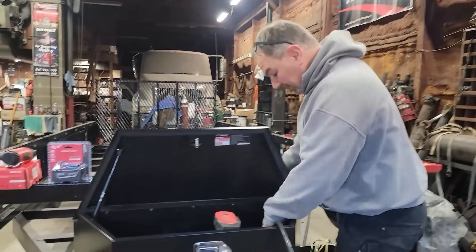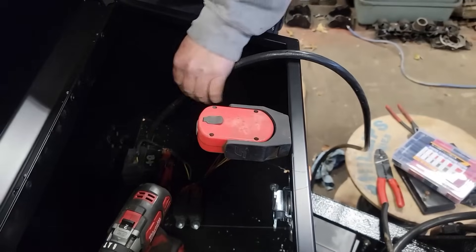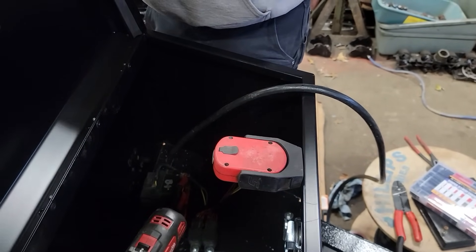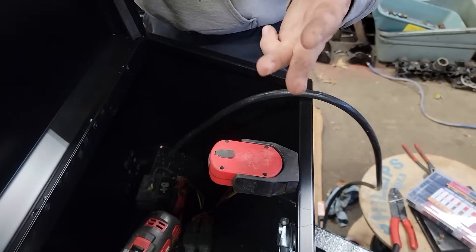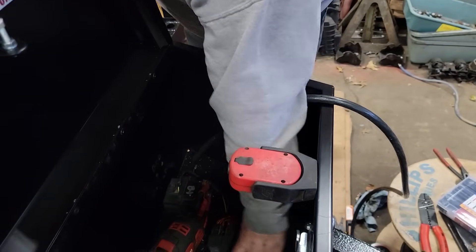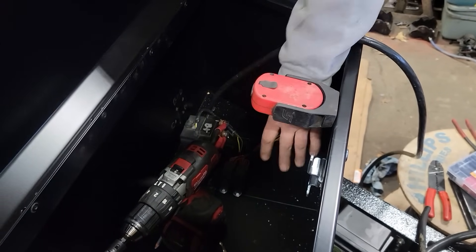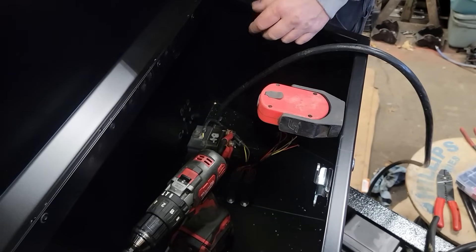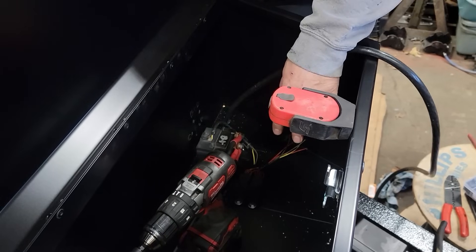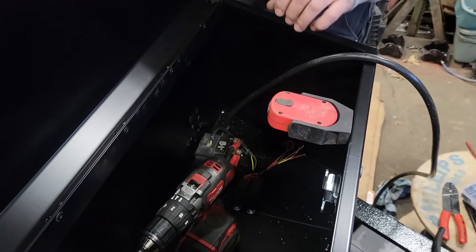I'm bringing my wiring in here now. This cable comes from our junction box down below and brings in our turn signal, left turn, right turn, backup light, a battery charge line, and a ground. We're going to set another junction box in this area and bring all our wires to a junction here. The reason to junction them rather than just splice is: one, we can add something later; two, testing is much easier if you have a problem because you have terminals to work with instead of cutting anything open.